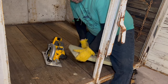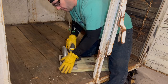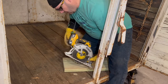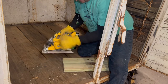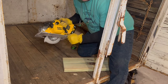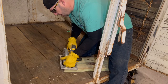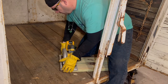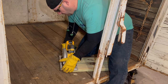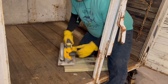This is the easiest way to actually set that — set your guard up. That lever pulls the guard up, and then I'm going to be adjusting this lever here: you undo that, this slides up and down — that controls your depth. So we're going to do that, set that down there, and you want that depth to be right there. Then we cinch that back down — there we go.